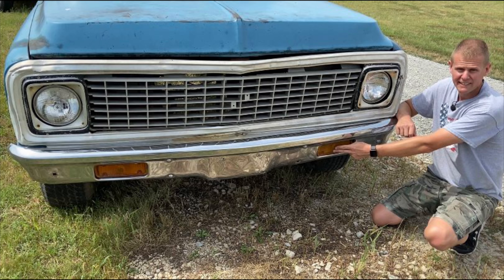This is one solid bumper. They would either come in chrome or painted. This would be the same bumper as the 1969 to 72 GMC, except at the top of the bumper there would be small cutouts for the park lights, as you can see in this picture. Another difference you may see on this bumper would be a hole on both sides for a vertical push bumper — an option that wasn't on every model.